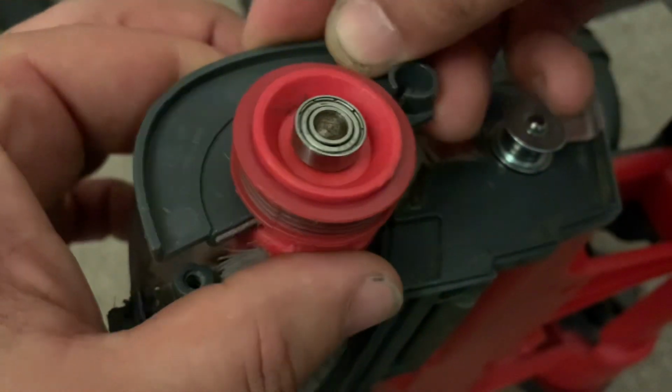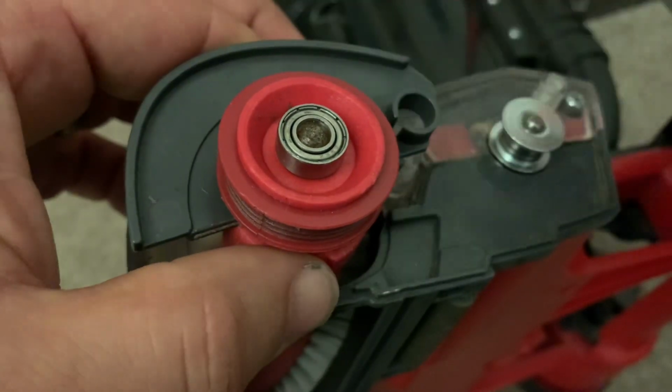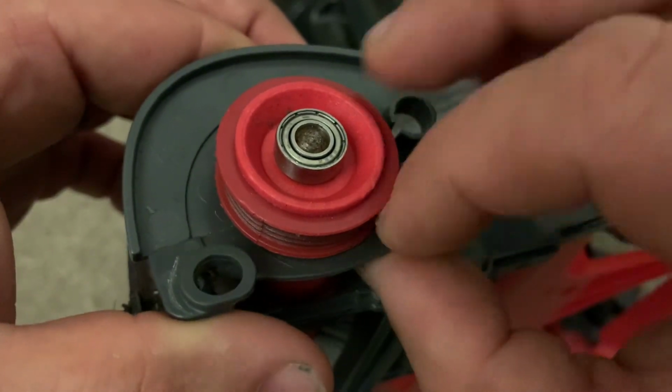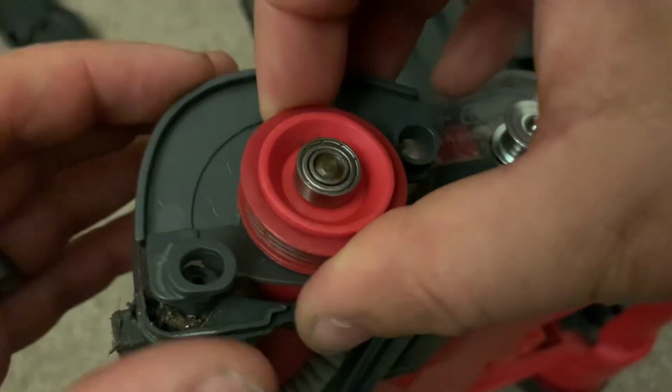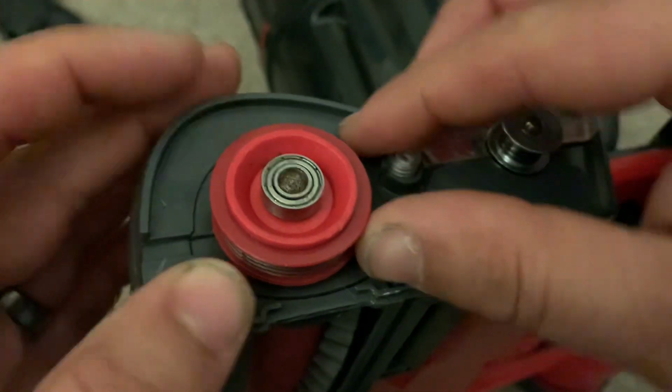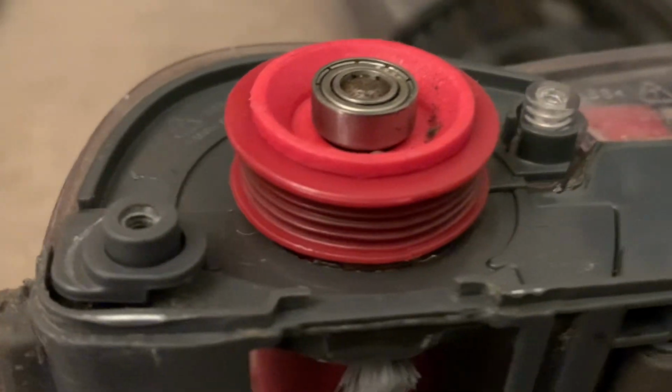First step though, is to put the collar around the brush bar. The biggest bit at the top, the smallest bit at the bottom, and then just lower it all in together. Once you have done this, it's time to make sure that the square part at the bottom of the brush bar is in place. You'll know when it's in place, it just feels right. Once you've got this in place, it's time to change the belt.